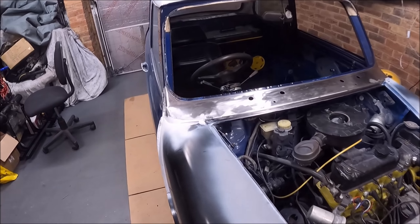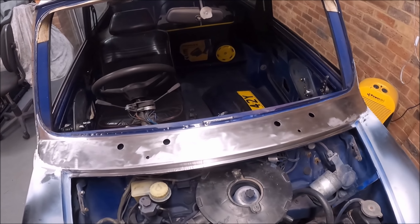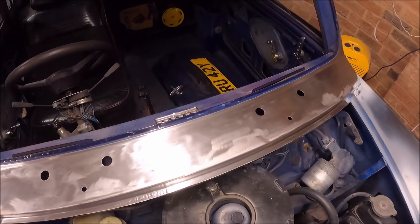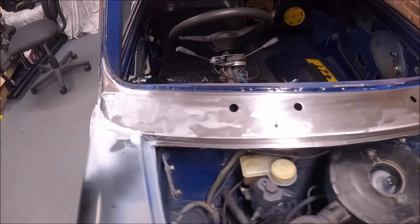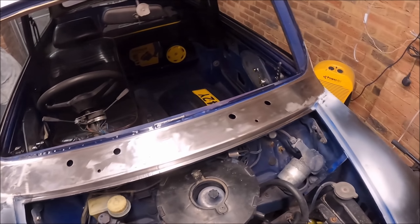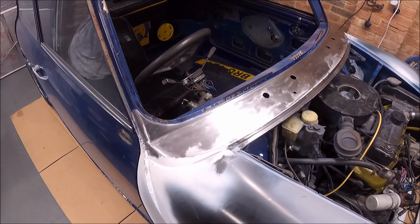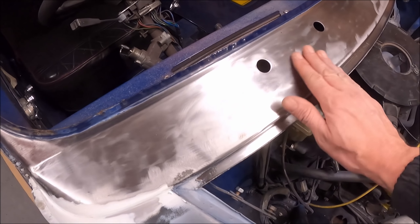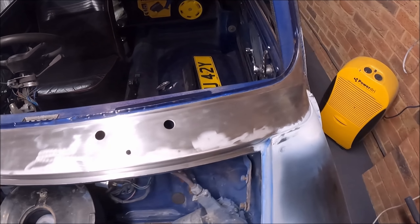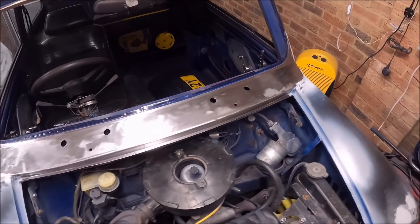Fast forward half an hour, 45 minutes — as you can see, I've taken all the paint off. MPI owners are going to hate me — this is the original scuttle, 40 years old, and you can tell because there's a chassis number stamped into it. And there is no rot at all on that scuttle — well, there's a tiny little bit down in this corner which will just be cured with rust treatment. I was trying to be as light as possible with the strip disc but every now and again you could see metal sparks coming off it, so I'm going to give the whole lot a very, very light skim of fine filler and rub it back to pretty much nothing.